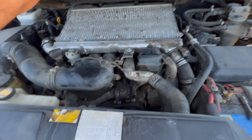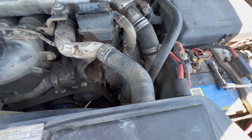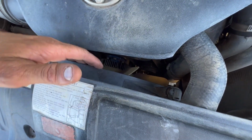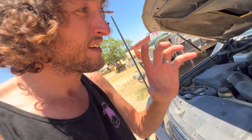I've taken the bolts out of there. Now, here is our temp sender. That's our temp sender that goes into the top of the radiator. That's the top radiator hose there, and there's the temp sender. If we could tap into that temp sender, get a big 12-inch, 14-inch fan that'll sort of bolt onto the fan cowl there, get rid of that viscous fan hub altogether, and go back to so that we can actually adjust where we want to set our fan to cut in and out.